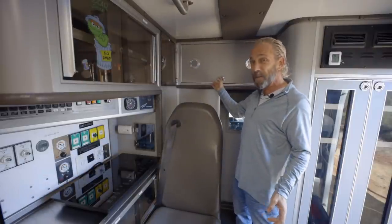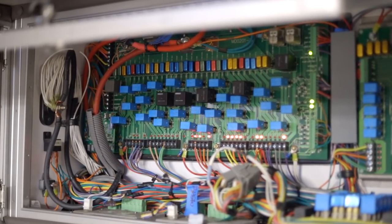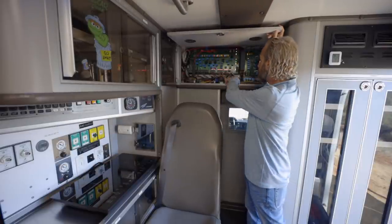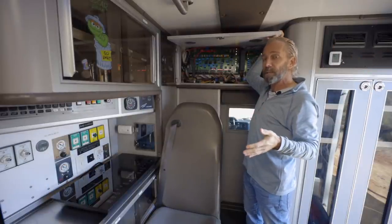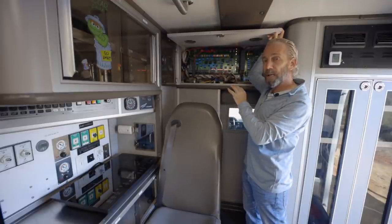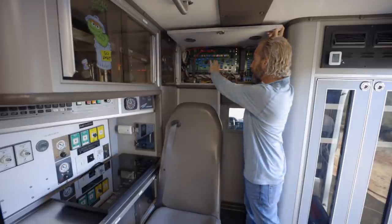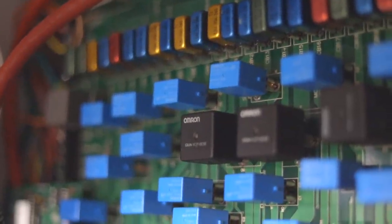The electrical can be a little intimidating when you first look at it, but one of the most amazing things about ambulances is that every wire has words on it. The ceiling panels come down, so if you're looking for something like the dome light, trace the wire labeled 'dome light' and you'll find it. Don't be intimidated. A lot of the way the ambulance works is that to keep first responders from fully discharging the batteries, they had timed relays that would turn on and off. I basically intercepted the wiring and ran it into the solar and battery system, which I'll show you soon.